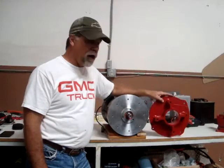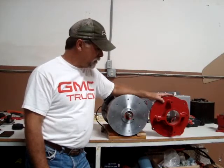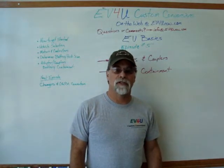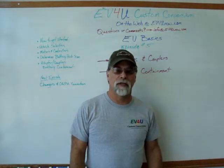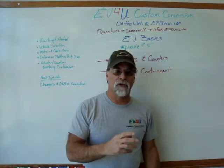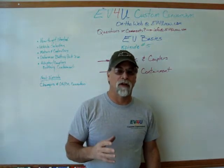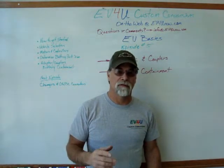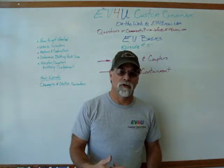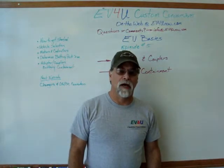This is something that you can buy off the shelf for a lot of different vehicle makes. You need to couple the motor shaft to the transmission, and that's where the coupler comes in. It has to be able to mount securely on the motor shaft and then be able to support our flywheel and clutch assembly, which then allows your input shaft from the transmission to be operated.